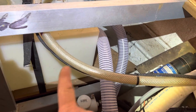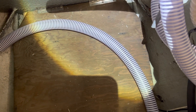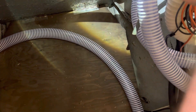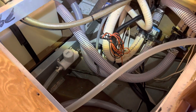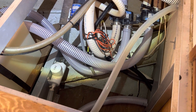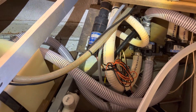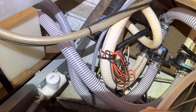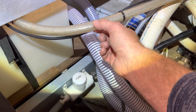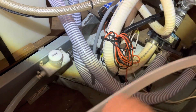I did move my blackwater tank up here — it was located down in this area — and now this is going to be a huge nice open area. I'm not sure exactly what I'm going to put here; I might be putting in another freshwater tank to increase my freshwater capacity. Just to recap: this is a cheap option — go to an ag store, go to the chemical hose section. I'm running inch-and-a-half hose here, a three-quarter inch vent hose, and a three-quarter inch supply line that provides raw water to my toilet.